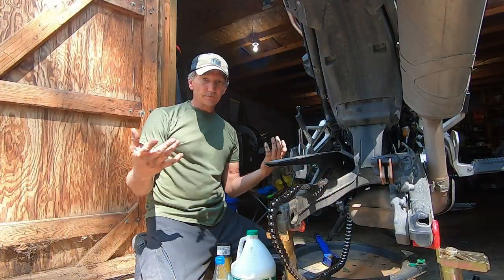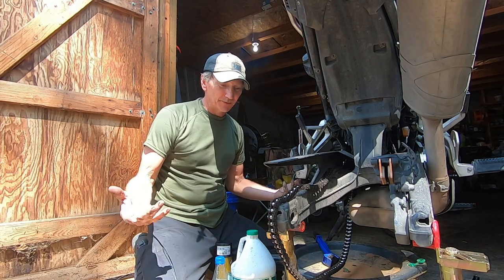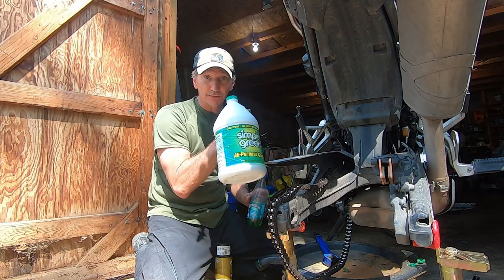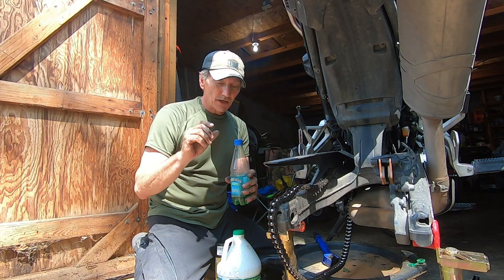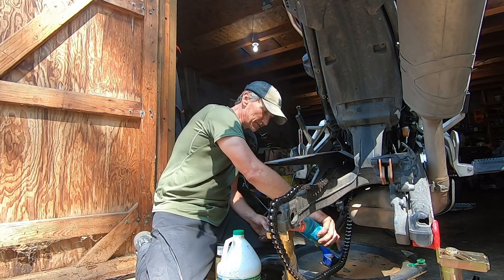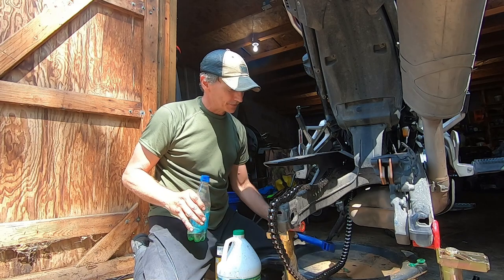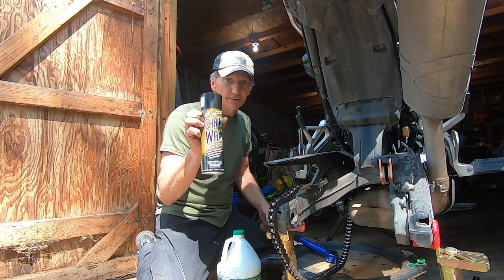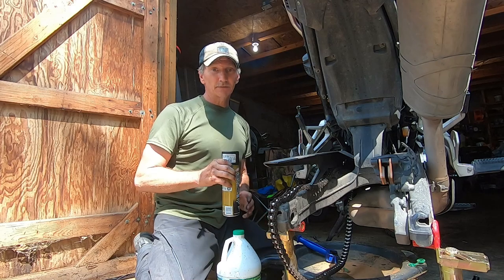The way I clean the chain — I use this method most of the time because I'm on the road and I don't have the luxury of a garage. All I do is carry Simple Green in a little water bottle, and I've got two tops — one lid I've poked a hole in, so I have something I can just splash on the chain. I just use a chain brush and go to scrubbing it. After I get it good and clean, I wipe it down, dry it off, and then I use a chain wax or whatever you prefer. This will take a little while, so catch you in a minute.